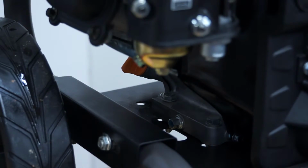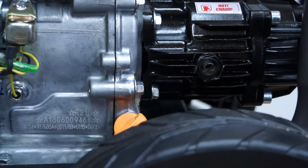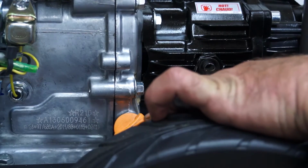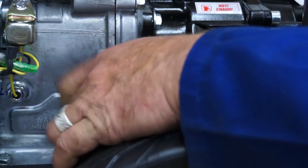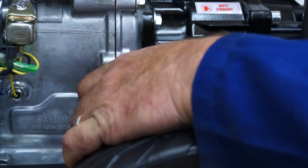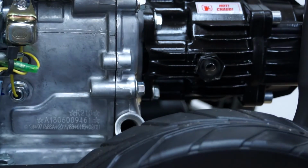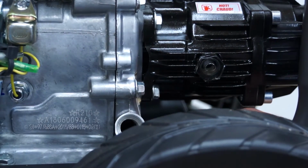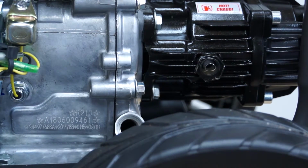That's the oil removed. You'll see that there's two orange plugs on the engine, one on both sides, but this one's probably the easiest to get to with your oil bottle. If you undo the filler plug, I'd normally recommend checking your engine oil level every day. Then you'll need to fill up the engine oil until it reaches the top of the threads, so that it's almost about to pour back out when you've got the machine on level ground. So let's just demonstrate.